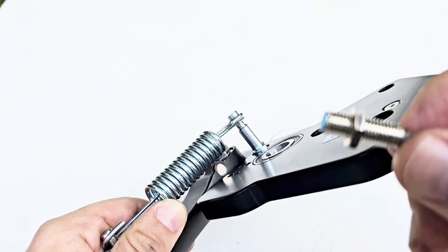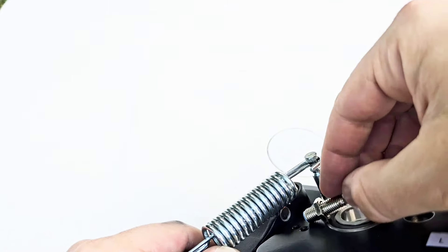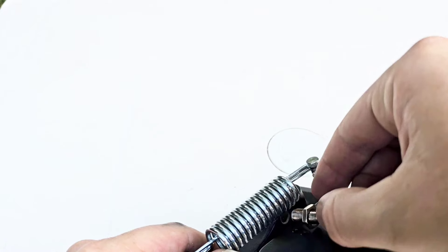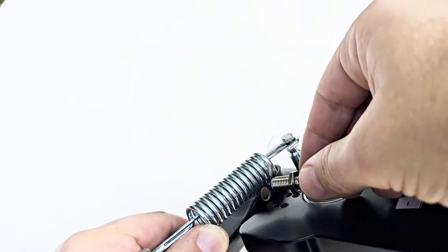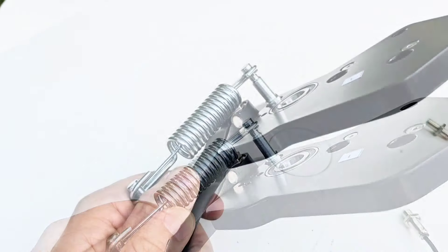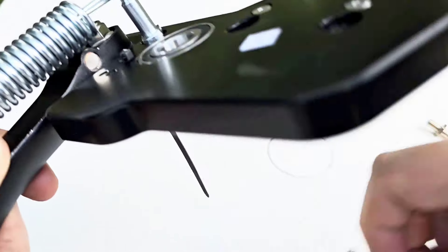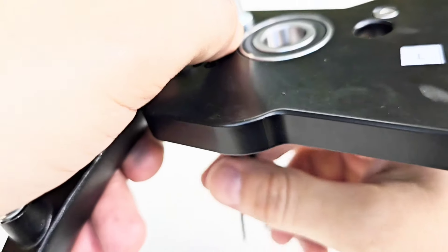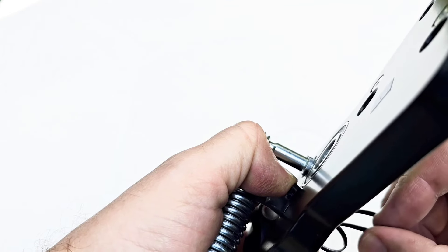If you want to install the side stand sensor, the sensor must be touching or really close to this metal point on the side stand. You can measure and move the jam nut backwards until the sensor is flush against this metal point and centered between the two holes. Once achieved, put zip ties through the two holes and have them coming out on the same side.